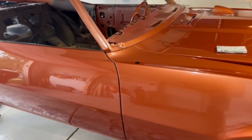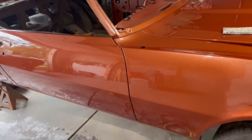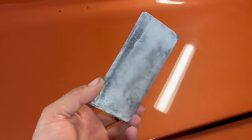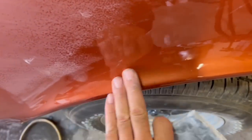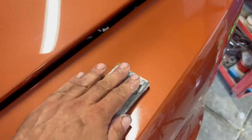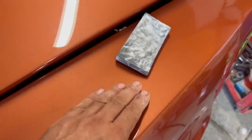Look at that reflection — you saw it come right back. You can see the crap on the garage wall! There's one more step — once the car is all done, we'll come through with a micro super-fine polishing compound. But look at the finish: it just lines up nice, super clean. The transition between the door and the fender is nice and even, the reflection doesn't change — that's what we were going for. The secret? Lots of prep work, getting all the behind-the-scenes things done. That's where you're in control. For the flexible block — use it on tight radius areas like the top of the fender. Don't go barehanded; the flexible block is for those tight curves.